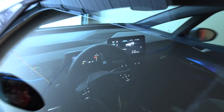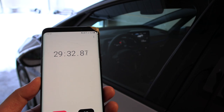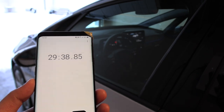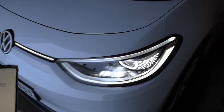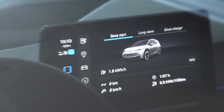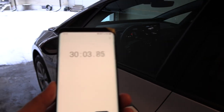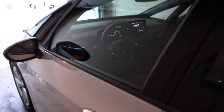It's been almost half an hour. I restarted the car right before I started the clock so it should be spot on half an hour. You can see the lights are on, and normally when I camp I would switch off the front lights manually. Right now in the garage it's only minus 3 degrees and the car is pulling only 1.8 kilowatt-hours to maintain heat in the cabin. We've passed the half-hour mark and it seems to still be on!